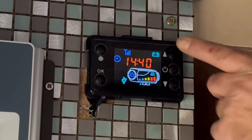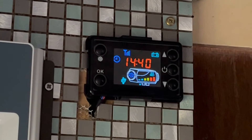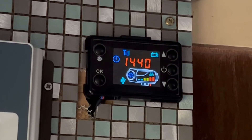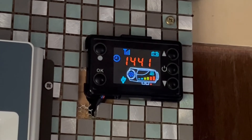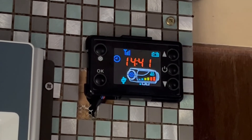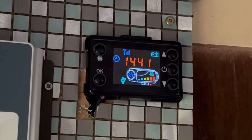So it is just those two buttons to get the H to come up on the screen, and this button here will prime it for you. But like I say, try to get as much diesel in it up to the pump as you can, because while it's priming the pump is clicking and it will cause wear since it's lubricated by the diesel itself.